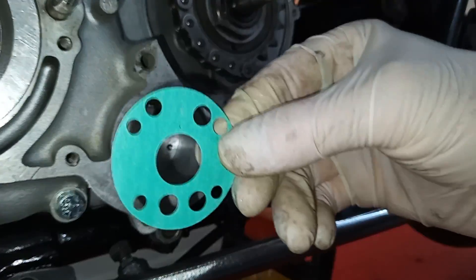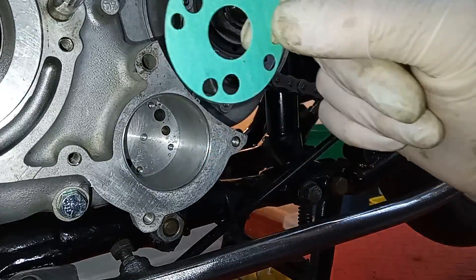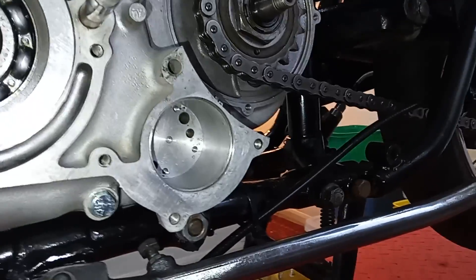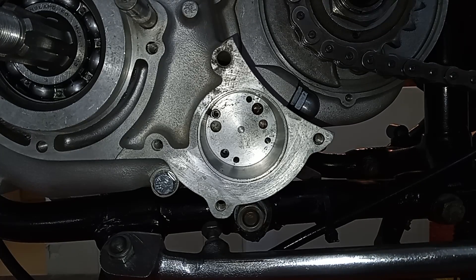In a minute we're going to put well seal on the end and then put the gasket in. We don't really need it because if it weeps it doesn't matter, it's not going to leak outside of the engine — but I'll do it anyway to guarantee 100% oil pressure. The most important thing is there are lots of holes in the gasket and lots of holes in the back of the crankcase.